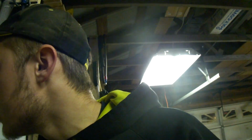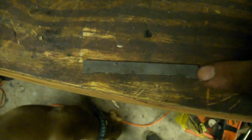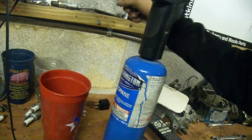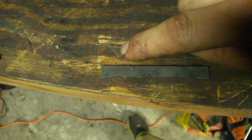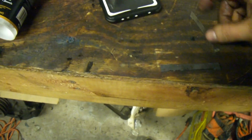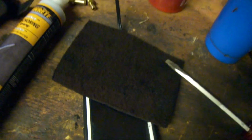You can use one piece apex seals, which look something like this. So this is a one piece apex seal. You see from spring to spring is one piece. And the two-piece apex seal would look like this, where you have a corner missing, and that's so that you can build it and also for heat expansion, because this will grow and shrink as the motor runs. Fun stuff.